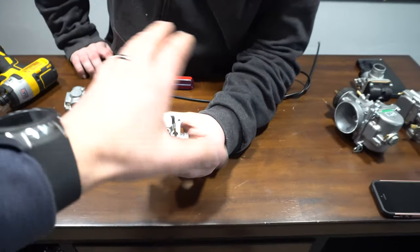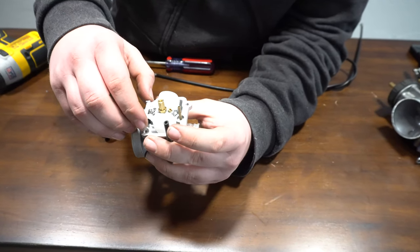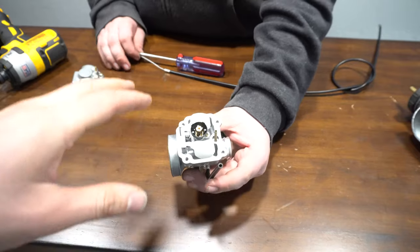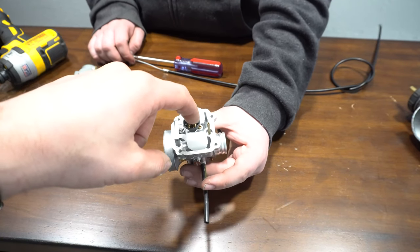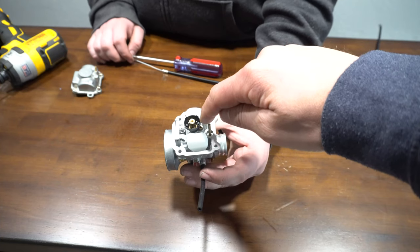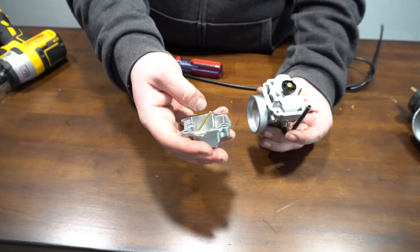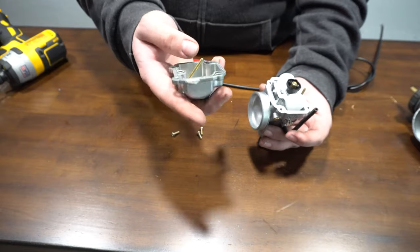Your pilot is right here. Usually the CPs come with a little bit too big of a pilot, so that's why you order the kit and tune the pilot jet. The pilot jets between the Keihin and Polini PWK look similar but they're not quite the same — make sure you have the right jets. Any carb you put on your bike, there's not going to be a carb that you put on, other than the bone stock carb, that is bolt-on and go. Every single carb you get, you will have to tune for your bike, your elevation, and everything. It's really best to buy a jet kit — individual jets are about six to seven bucks each at a motorcycle dealership, but you can buy a whole kit of 20 for about 20 bucks. You cannot buy CP pilots anywhere individually — they're specific to the CP. You've got an O-ring gasket here, which seals better than paper. It'll last longer and is less prone to leaks.